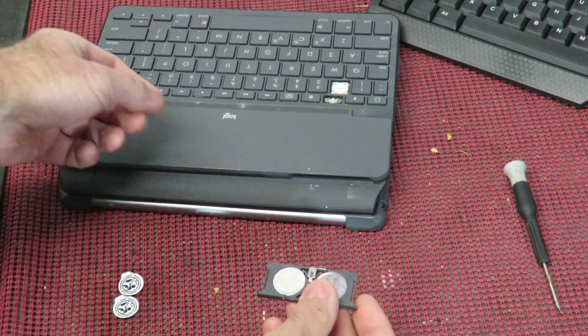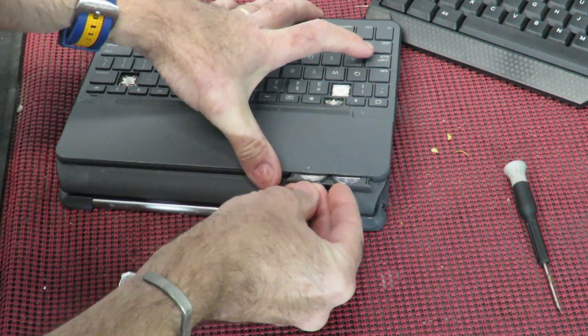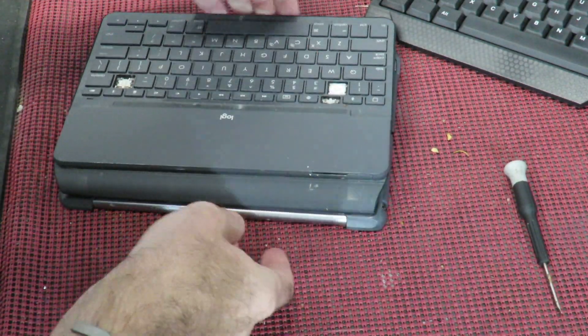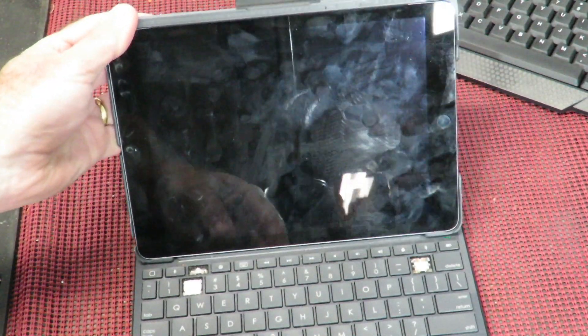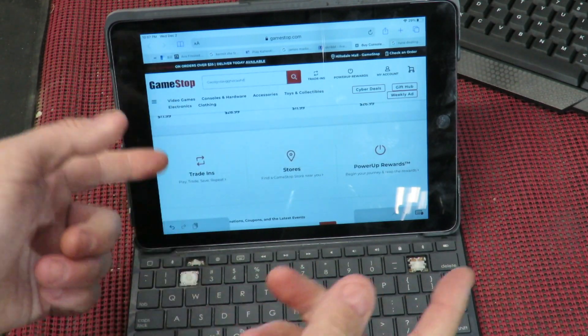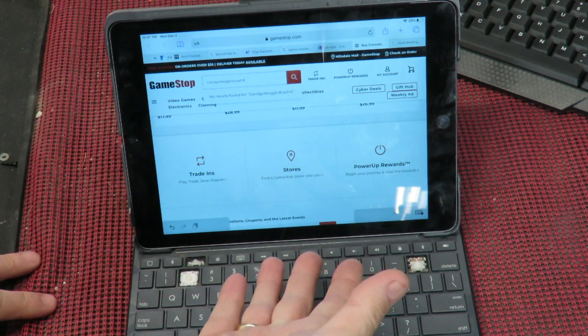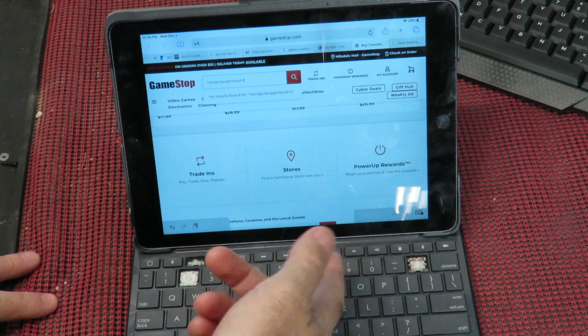Same with the second battery — lettering facing upwards — just push it in carefully. Now, slide the tray back in and make sure it clicks in nice and firmly. Moment of truth: the keyboard clips on, the light comes on, and the keyboard is fully working again.